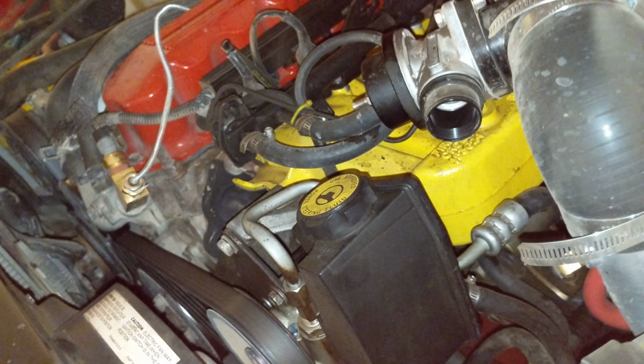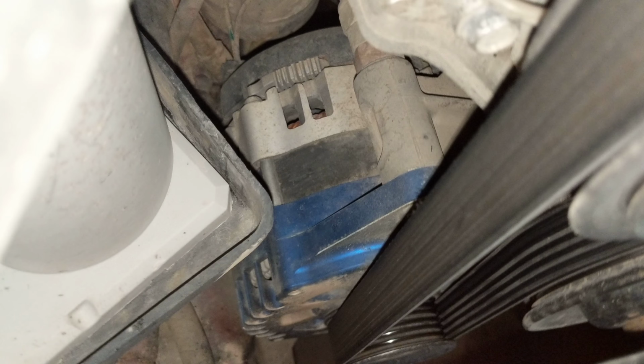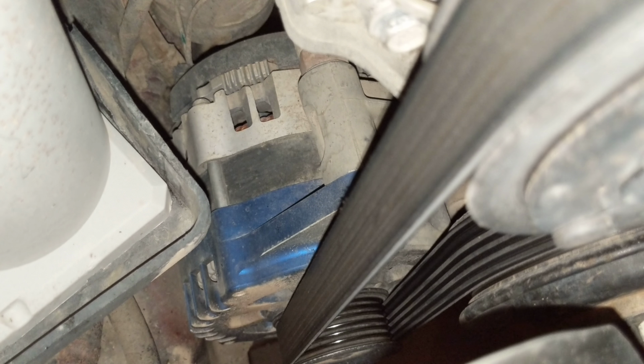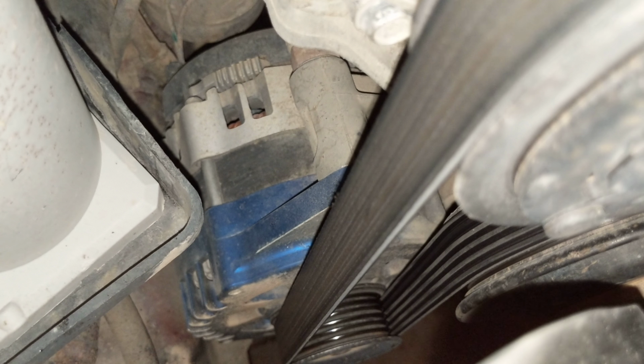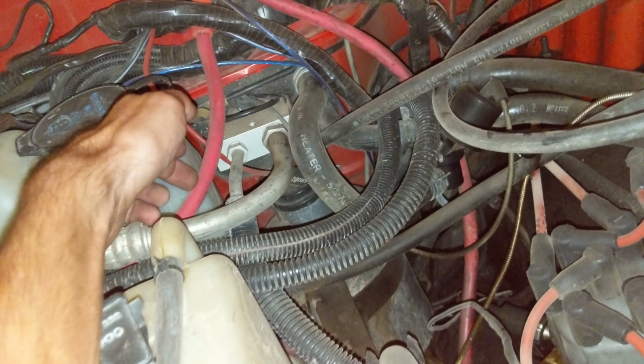When it sees boost, it just goes into a limp mode or whatever and acts up, goes all lean. Fuel pump stock. Injectors I upgraded, they're 26 pound. Let's see what else. Oh, got a DC Power Engineering alternator that puts out 270 amps at 4,000 watts, so it will power just about anything. I had to upgrade to these big old wires, and the grounds are even bigger.